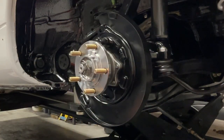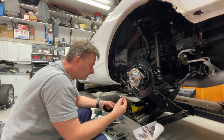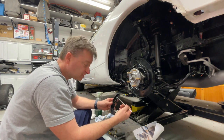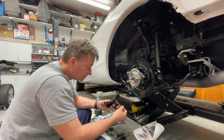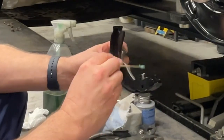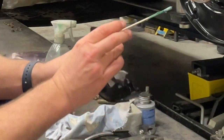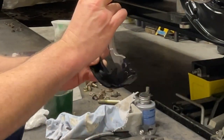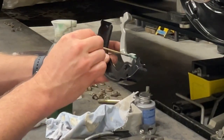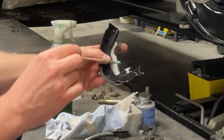And then there's a few things on the brake shoe itself. You should do it where the tensioners all go, the adjusters. Like I said, you don't need much in here, so you just get it on there. Don't forget where your actual brake cable goes. It's a little bit in here. We'll get that in there, which is the notch that helps do some adjustment here.